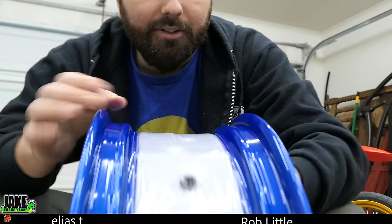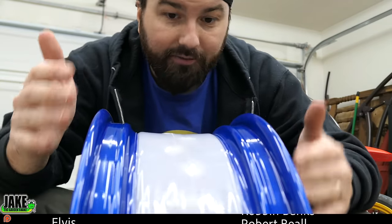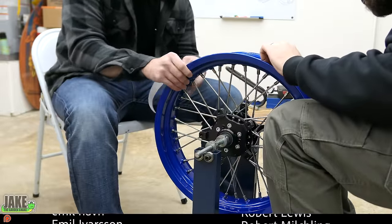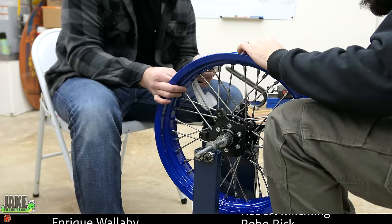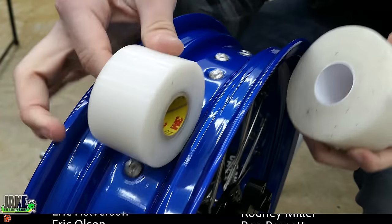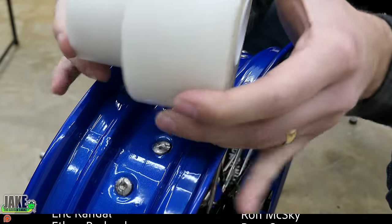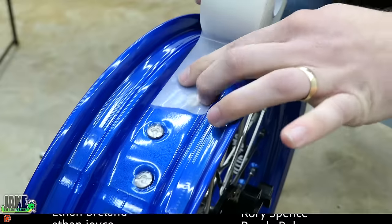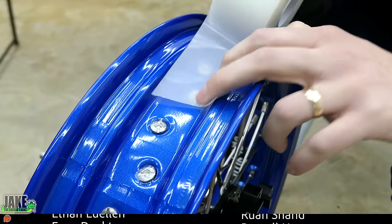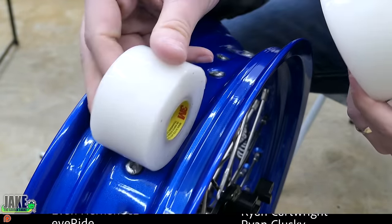That's our procedure for making a tubeless wheel — there's our valve stem, our overlap, our tape. Now we're going to do the same thing to the front. This is the tape we used last time — it fits in the rim but doesn't leave a lot of room beside each nipple. We've got this other tape we used on the rear last time; we think it'll fit in real nice. It might roll up the edges just a little bit, but not enough to wrinkle. If it starts crinkling, we'll go back to the first one.